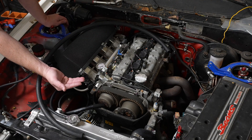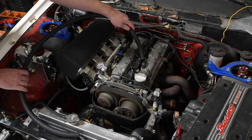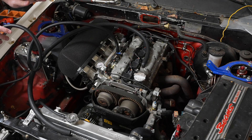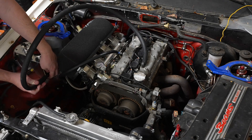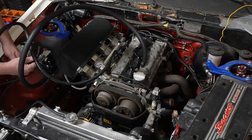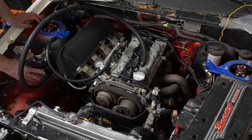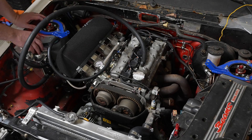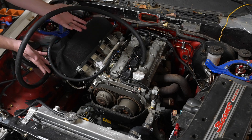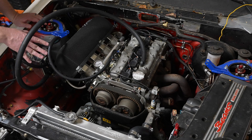For an aftermarket ECU with a MAP sensor or with ITBs, we're going to run two lines — one from the fresh air vent and one from the PCV — and I'm going to run both of these to the same catch can. One line goes in one port, the other goes in the other port. That's how simple it is. Both of them go into the same baffled catch can, which will trap and capture all the oil vapors. At the top you'll just have the air you're displacing venting out. I prefer to run them separately into the catch can rather than tying them together, so there's no conflicting airflow.